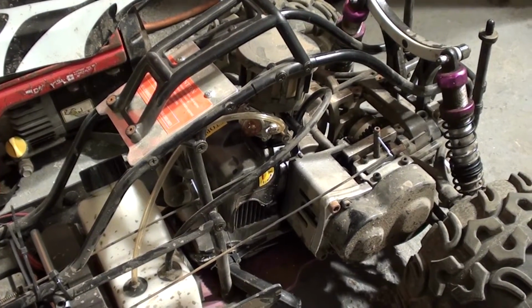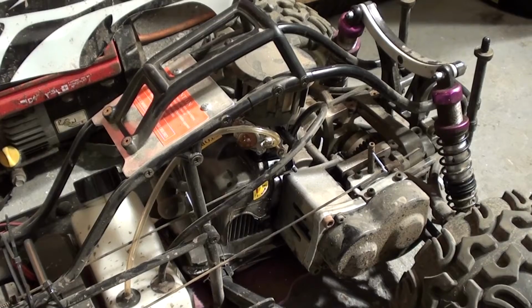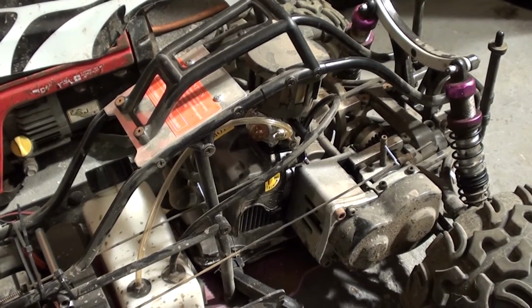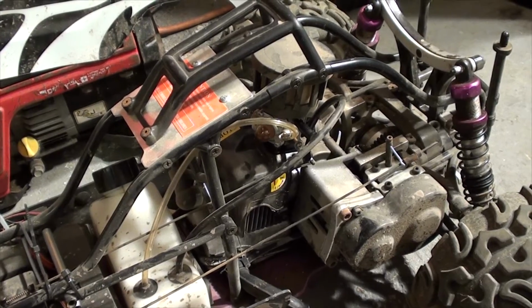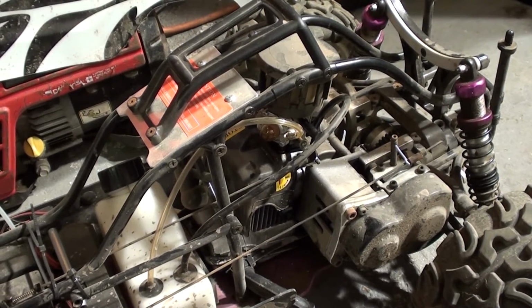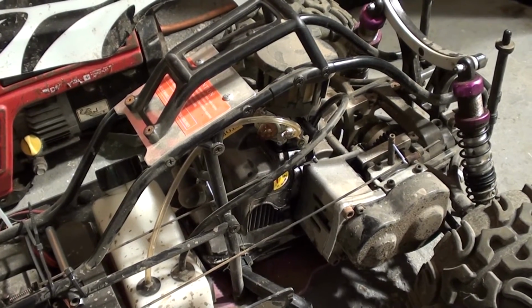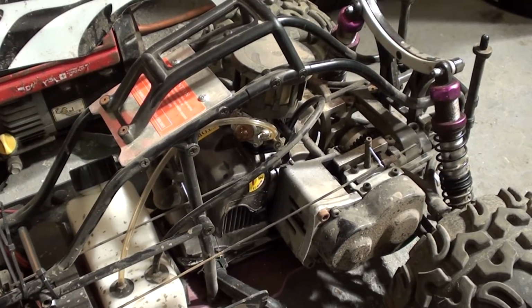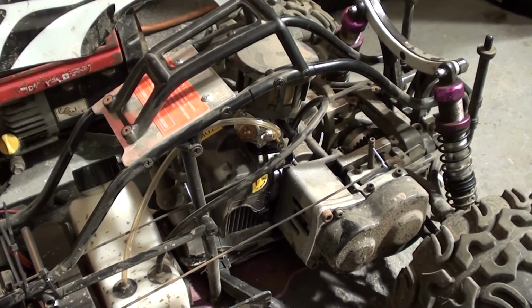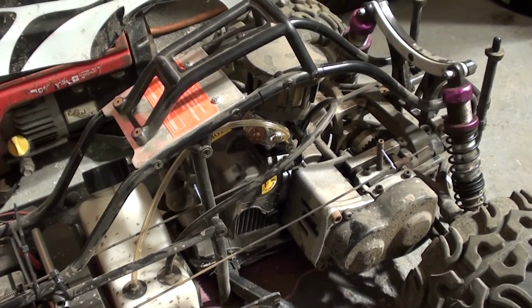And you've got to make sure as well that it ain't running too lean, especially in the colder weather. As the weather changes, you'll have to adjust the mixture with the screws. You will on any engine with a carburetor. Even modern cars with ECUs, it adjusts, but the computer does it itself because it can sense the temperature and it knows.